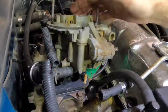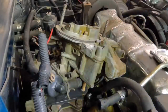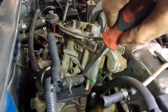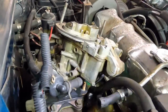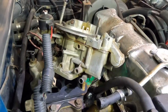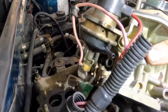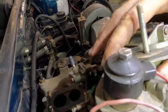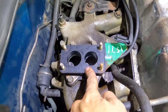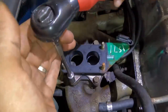That's the brake booster line, I think — yeah, that goes to the booster. Let's get that off. I underestimated that vacuum line. Alright, we're pretty much free with the exception of this little solenoid right here — let's unbolt that, bracket and all. Although this carburetor bracket looks relatively new, I'm going to pull it off anyway just so I can inspect the gasket on the bottom side of it. I hate to have to do this job twice.